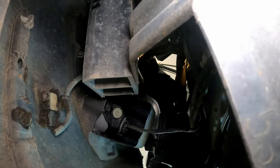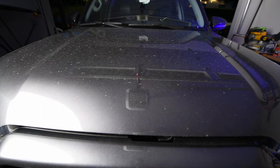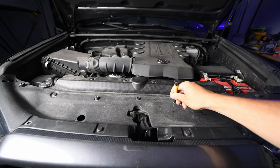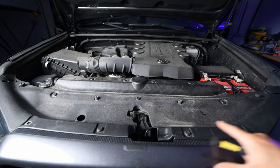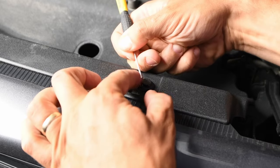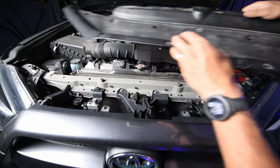After that, look up and disconnect your fog lights — there's a little clip there. Once you've done the nuts in the wheel wells, the bolts underneath, pulled the mud guard open, and unplugged the fog lights, open the hood and remove the cover. To remove the cover, undo these little clips — there are thirteen of them. Take a flathead screwdriver, get underneath in the corner, pop it up, and it should come out. Once all thirteen are removed, just lift up and move the cover out of the way.